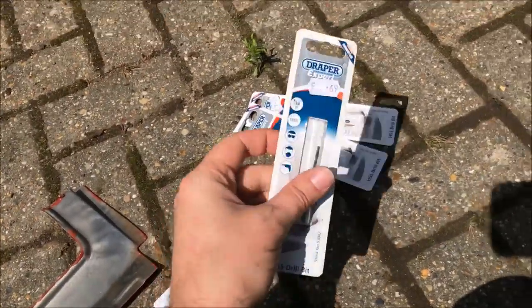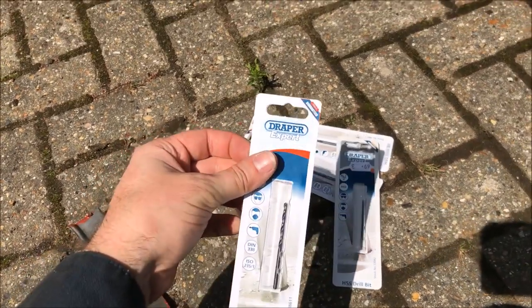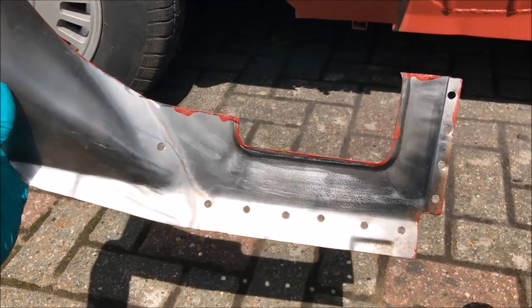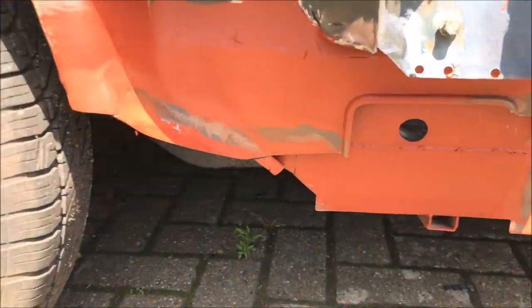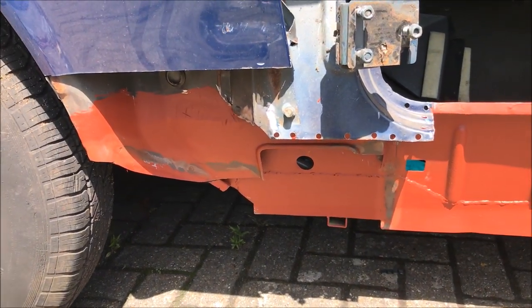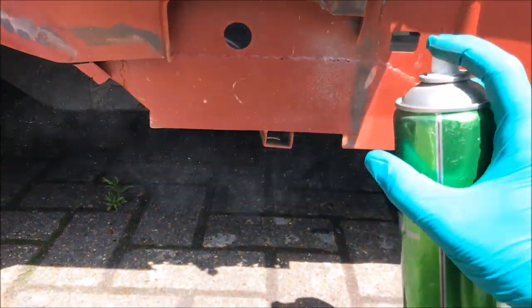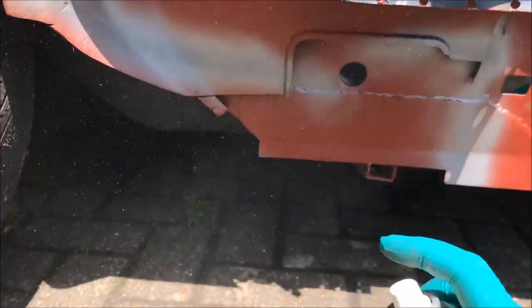Because I have a habit of snapping drill bits, I went and bought some more this morning. I usually buy them off eBay because it's cheaper, but I had to go to the DIY store — that's about 5 quid worth of drill bits. So I'm going to try my best not to snap those. Here's my panel drilled for the plug welds. On the car, where I'm going to put a seam, I've just taken the top of the red primer off and I'm going to shoot a bit of zinc weld primer on it, just to protect it.